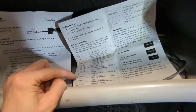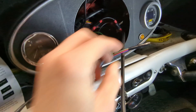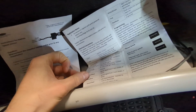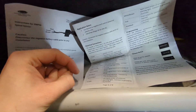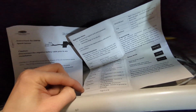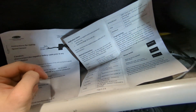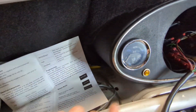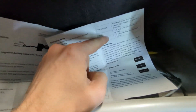White and black — I have a three-wire sensor, so white and black was the one I needed. Red and blue I've just set aside; unused, don't need it. Green and red is the left-hand indicator — I didn't use that, but it is an option if you want it. Purple is your oil pressure, or you've got white and brown which is also oil pressure — it depends which you want to use. I've got a mechanical oil gauge so I don't need that one, but if you've got it, you can use it.